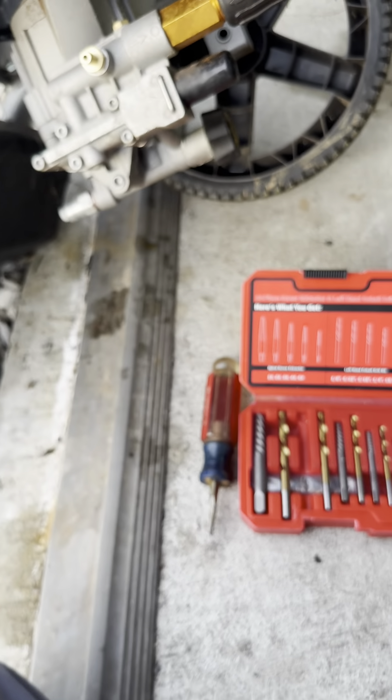I went in and bent the ears just a little bit back out. Now we'll go ahead and put this wheel back on. A 15 millimeter socket will fit nicely down over it, and then you can just simply hammer it on until it's flush against the wheel and your wheel won't bounce back and forth.